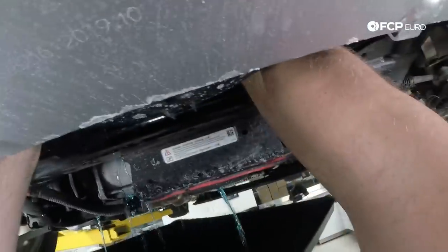Yeah, this is where it's terrible, draining this cooling system. There's no drain plugs. The lowest point is the water pump, so this is really the only way to do it and not make a massive mess. So it's either do this now and have a little bit of cleanup, or try to do it from the top and then have a lot of cleanup later.